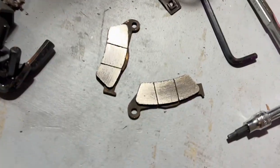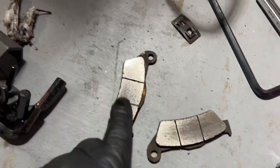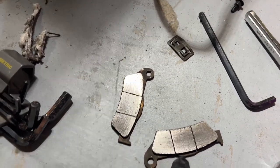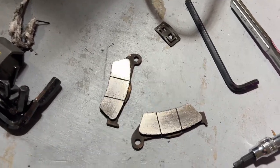I just roughed these up and believe it or not these grooves were actually full of plastic. I'm gonna get that out — those grooves are necessary because that's what allows the brake dust to escape so it doesn't accumulate on the pad. Let me get those cleaned up and we can start putting this stuff back together.